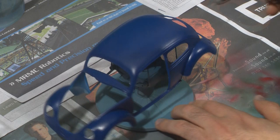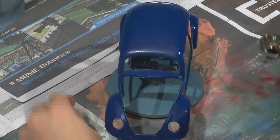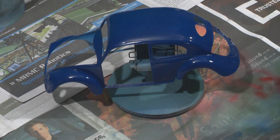We're spraying at about 25 PSI to make sure we get good coverage. The wet coat, as you can see, is already starting to make a really big difference on these fenders and down the left side of the car. You can really see the gloss coming up now — we've got a nice mirror-like finish there already.